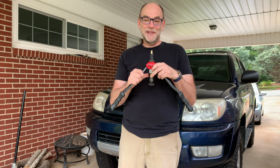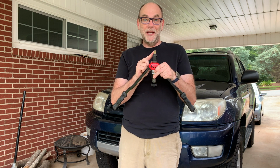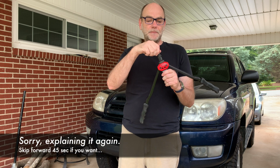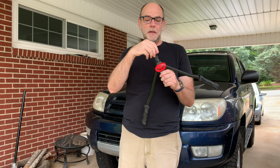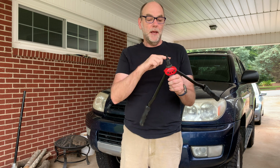So now we're on the next day. So what we have to do next is we got to put a nut rivet up in that hole so we have something to thread into and mount this side. And if you've never seen the nut rivet tool before, this is what they look like. These are the nut rivets here. They're just a rivet-looking item here with threads in there, and this is the tool that you can get them everywhere.